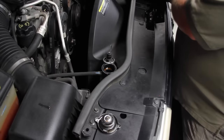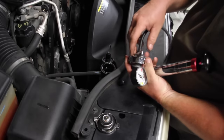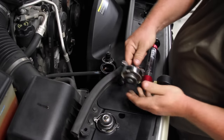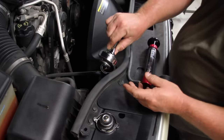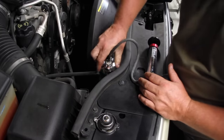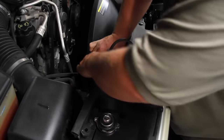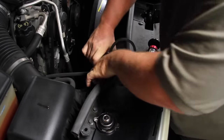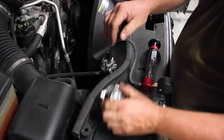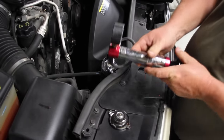We're going to take the pressure tester and put it on there. For this particular kit — and there are tons of different ones — you want to install it with the cross piece on top, like this. When it goes on, you twist it, then pop it so it locks in. That's the same action as the spring mechanism — it just holds it back. So let's pump it up and see what we get.